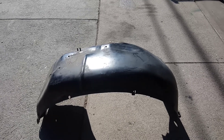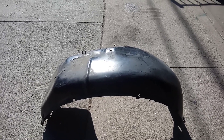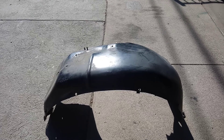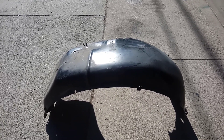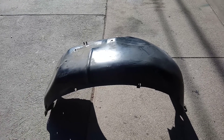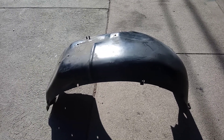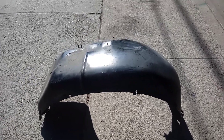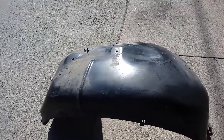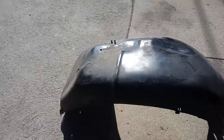In this case, we are going to improve upon the original construction, which had an undercoating on the underside of this inner fender. We'll apply undercoating on the inside, and then the top will be restored like the original semi-gloss black.